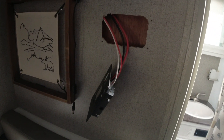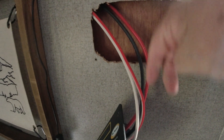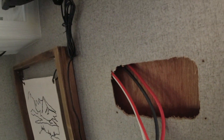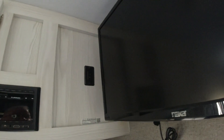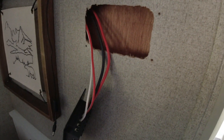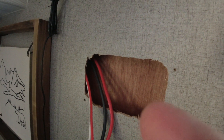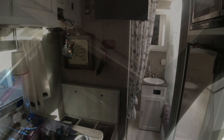After pulling this down, it's not going to work out the way I thought. I thought the wires were coming from the roof on one side then going down under the camper to the battery on the other side, but they're both going up this way. I'm going to have to search these wires — looks like they go over the top. So I'll put a piece of paneling in this section, with a terminal board on the back side, then run another cable down to my seat area and mount my controller and breaker down there by my water heater.